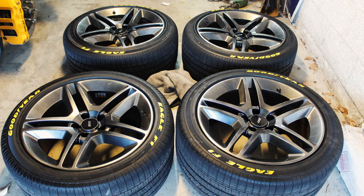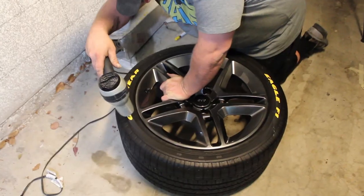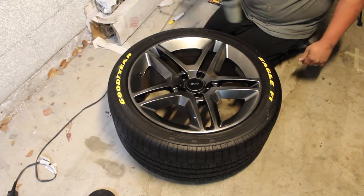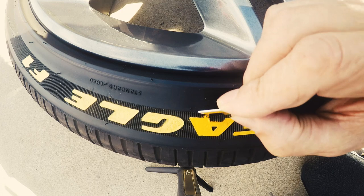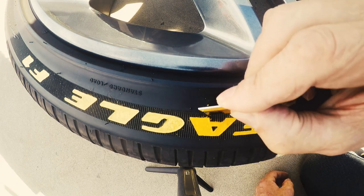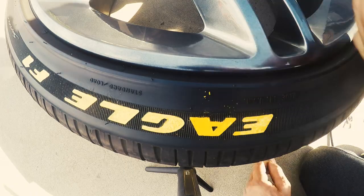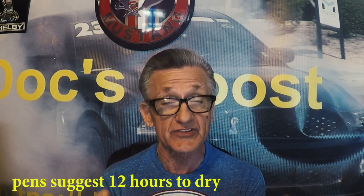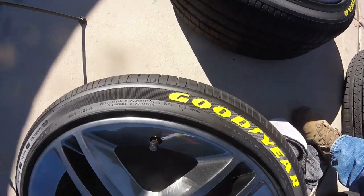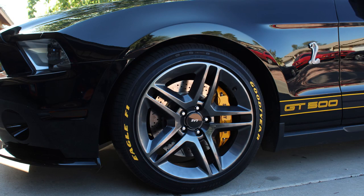And when I say done, I mean done painting — because you're far from being done yet. Now that you've let the paint dry — and I used a hair dryer to speed up this process a lot — once dry, it's time to take a razor blade and trim off the runoff to square up all the letters. Using the razor blade too early lifts the paint right off the letter, and that's a result you don't want. So make sure the paint's dry before you start using the razor blade. After the razor blade cleans up the tires, they look great. Amazingly great — the wow factor is set for sure.